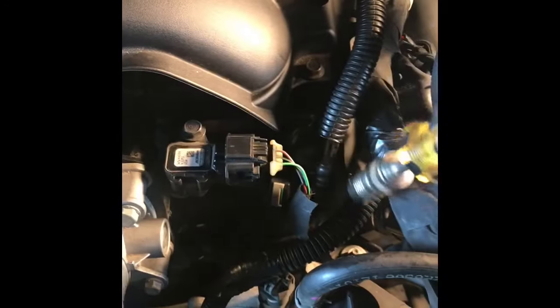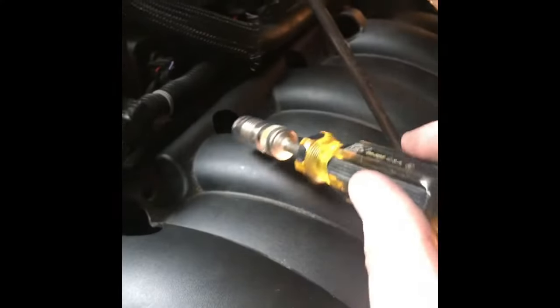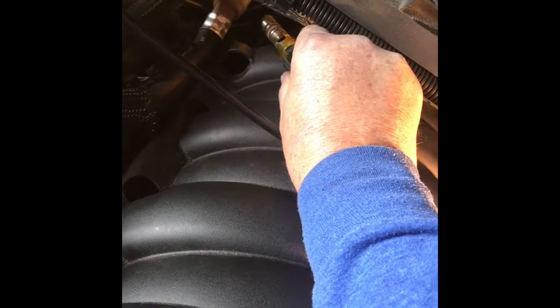So you've got a screw hole there, and there, one there, one there, and one up front. You see it down there, the bolt. You got one there, there, there, there, and then all the way to the back. You can get that extension back there. You can get it. And tighten that one. I kind of went from the middle out, like on an engine block. Staggered it and tightened it down that way so it snugs up nice and even.